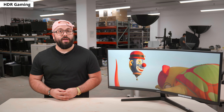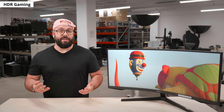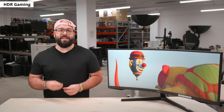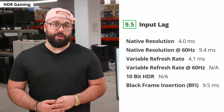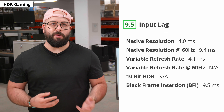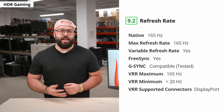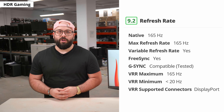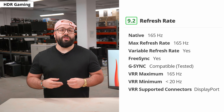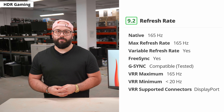Now let's look at HDR gaming performance. HDR, or high dynamic range, is a video format meant to increase details in dark and bright scenes. Like with gaming, it still has quick response times and low input lag. We didn't measure HDR input lag because you can only hit a refresh rate of 100Hz over HDMI, which doesn't meet our testing standards. In 10-bit HDR, the max refresh rate over HDMI is 60Hz, and you can hit 120Hz over a DisplayPort connection. To avoid VRR issues in HDR, we suggest setting the monitor's refresh rate to 120Hz over DisplayPort, because we didn't experience any issues with that.